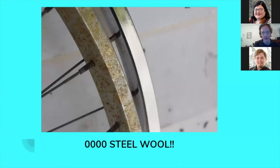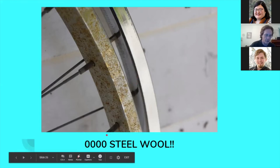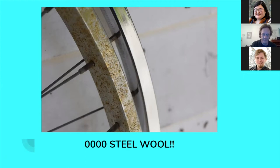These are the wheels from this bicycle. The one in front I haven't cleaned yet — you can see all of this surface rust looks really nasty. The one in the back is after I've cleaned it. What I used was a product called Quadruple Zero Steel Wool. If you're polishing rust off of chrome, make sure you get Quadruple Zero — that's four zeros. It will polish up the chrome and will not scratch it. If you use Triple Zero steel wool or an SOS pad, you will damage the chrome, scour it, dull it up, and it will also make it rust much more quickly. So make sure you go out and buy Quadruple Zero — four zeros — steel wool. It's available at hardware stores and home centers.